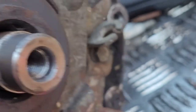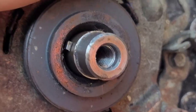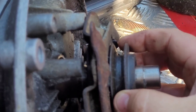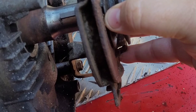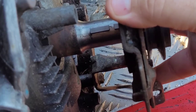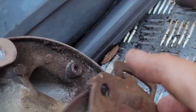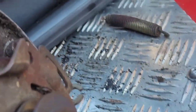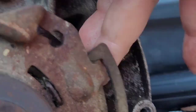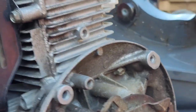That should sit there, and make sure you've got your cable — which I've got the wrong way around, that needs to be up here. All you need to do is just spin and pull that out so it gives you enough clearance. Then just spin it round until you want that there, and then just push it back on. It slides over nicely. You can see where your cable comes through and attaches there, which obviously moves your clutch.